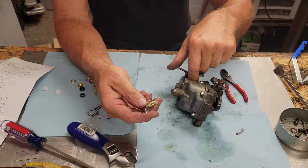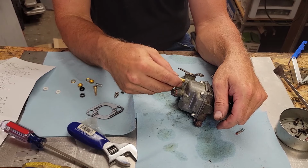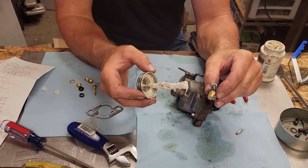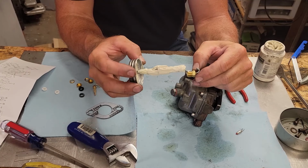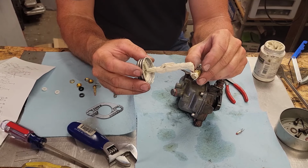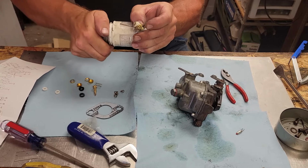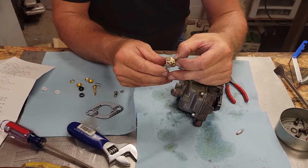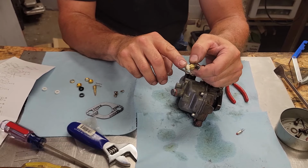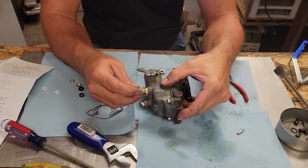This is one thing I really like about this carburetor kit right here. You see, it's got this little radiator petcock that goes in there. I like these a lot better if you want to drain the gas out. So I gotta go get me a little bit of sealer to put on here. Just use a little bit of pipe thread compound for this thing right here. Don't need a whole lot of this stuff on there, but you want enough on there where you're not gonna have a fuel leak. That's what I'm trying to get away from in the first place, because I've had a big fuel leak from the float sticking in it. You can imagine. And turn this fella in here.